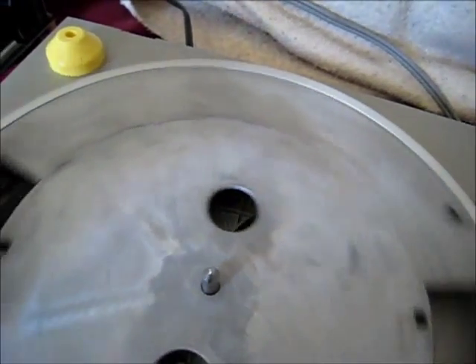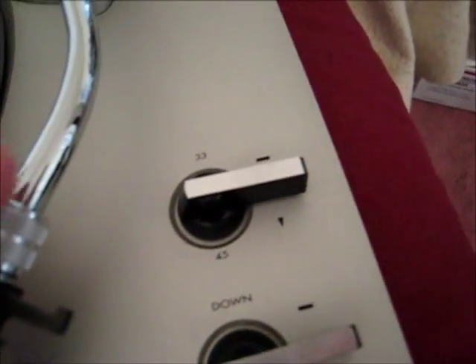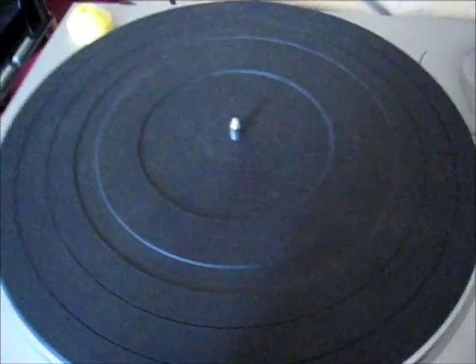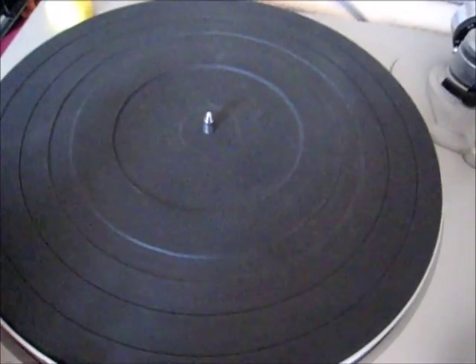You can watch it — it's moving fine. Move it around a few times just to make sure, both ways, even though the record player only moves one way. Once you're sure of that, put the platter back on. Then plug it in. You don't need speakers connected because you can actually hear a record without them. Try it on both speeds. Make sure it's actually spinning when you're not moving it. Then take a record you don't care about — a duplicate — a 45 and a 33. If yours has two speeds, or maybe a 78, make sure it's playing at the correct speed using a song you know well. If it's at the correct speed and moving smoothly without jerking or struggling, then it's fine.